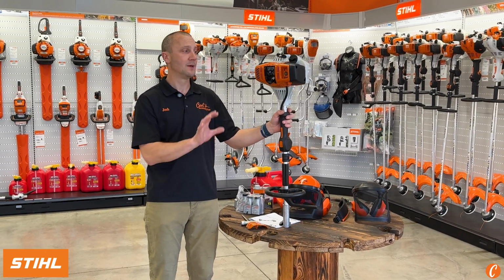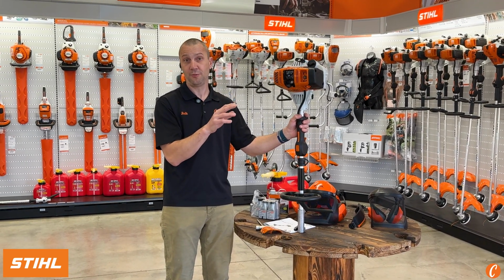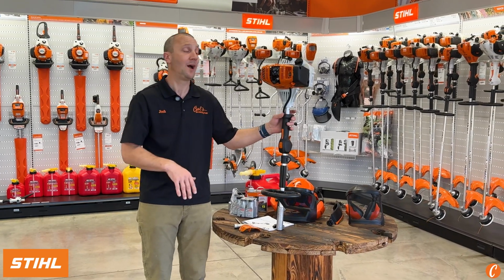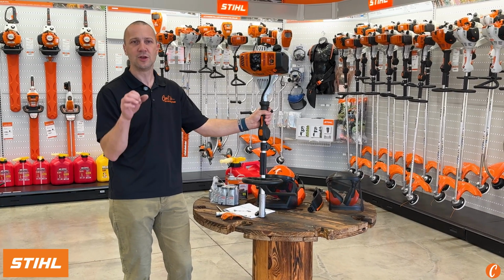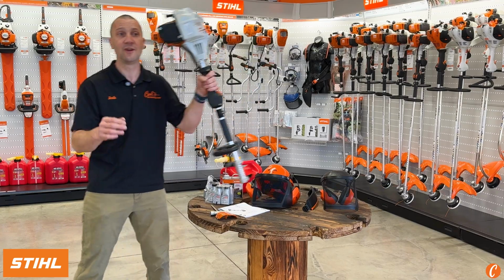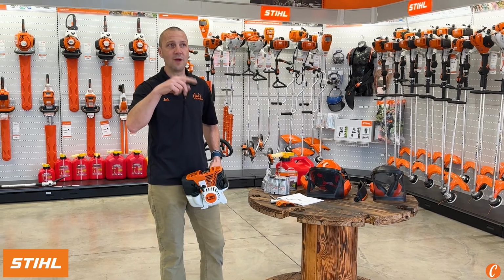Over time, these valves are going to need adjusted. And what'll happen is these valves come out of adjustment. It's natural. Your car, the same thing will happen, right? Your lawnmower, the same thing will happen. But as these valves come out or need adjustment, roughly 125 to 150 hours, you're going to get a chunkier pull because the compression release is not working as well. So instead of a fairly smooth, fluid pull, chunk, chunk, chunk, chunk, more like your grandpa's old chainsaw.